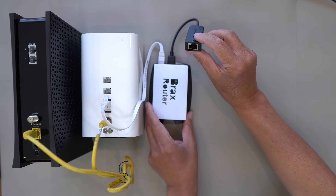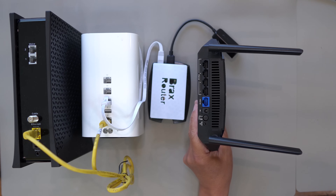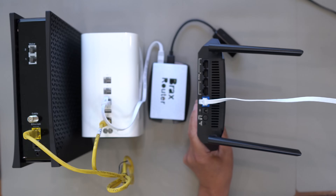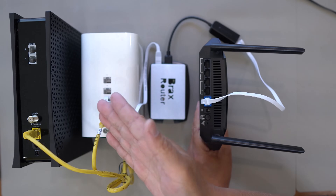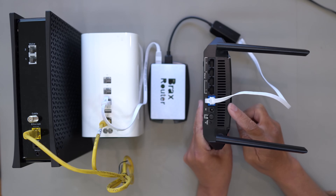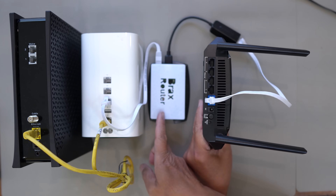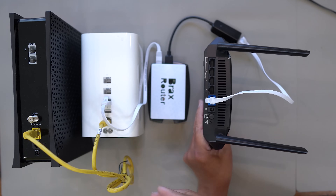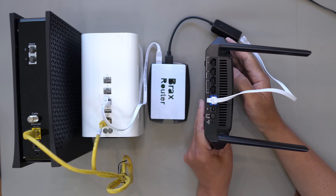You plug in the Ethernet dongle, and from there you attach it to a single Wi-Fi. You just plug one end into the Ethernet port on the Wi-Fi and the other end into the dongle. The difference from the original setup is this gives you a faster Wi-Fi — a $50 Netgear Nighthawk with 802.11ac, which is a faster protocol — so you're no longer limited to 50 megabits per second. That's why the setup is actually very flexible.